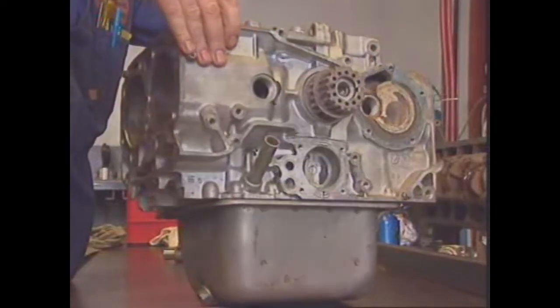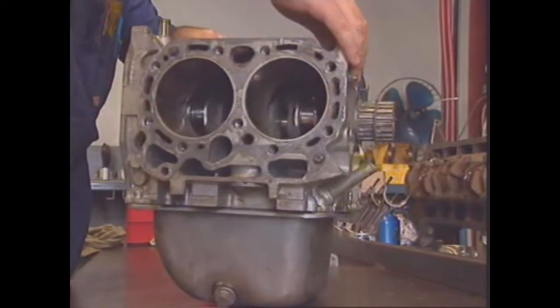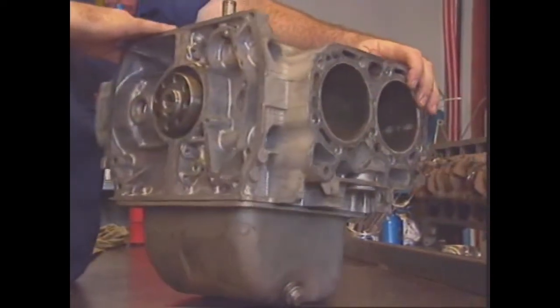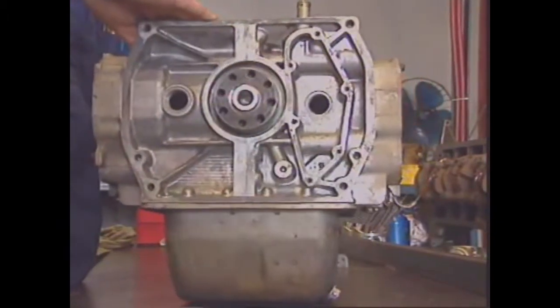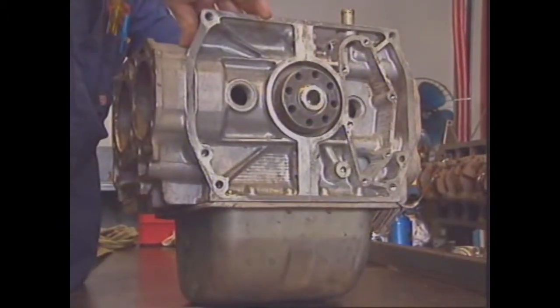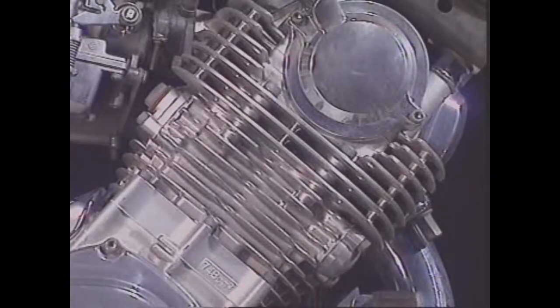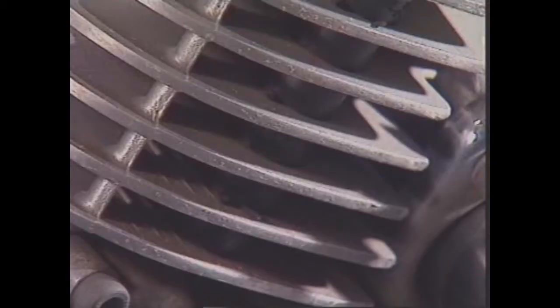This is called a horizontally opposed block. It has a split crankcase. The two engine blocks are joined together by the flanges of the crankcase. In air-cooled engines, the cylinders are usually made as separate parts, then bolted to the same crankcase. Each cylinder has cooling fins. They're often machined to give uniform thickness and allow free flow of air.